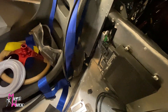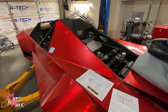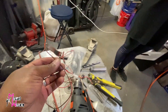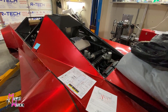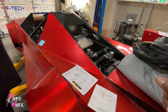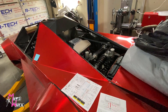That ECU and the entire wire harness you get with it is basically long enough to do a car. So when you're doing a motorcycle, you're cutting down what you need. Whenever you have something labeled like that ground wire, it's labeled every so many inches, so whatever you have to cut off, you're not cutting off the label. Every so many inches it'll be labeled in black or white. It's a very, very nice system, very user friendly — I can't praise it enough.